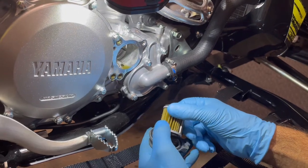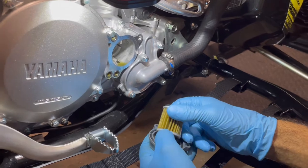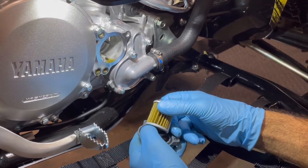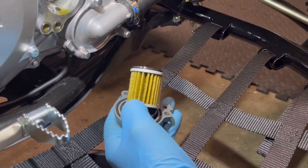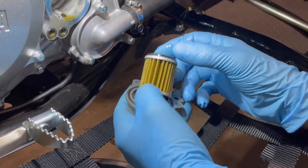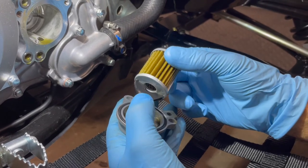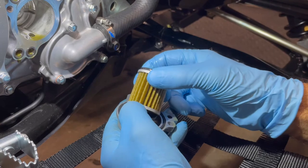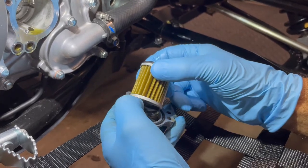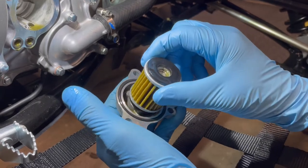And you can only tell that the bottom half of the cylinder is not going to survive very long with no oil squirting the bottom of it, which keeps that lubricated. So yeah, this little gasket, I've seen this little thing cause many problems. I think I probably did, like I said, four engines last year for that. So really, check the backside of this cap, look at it really good.